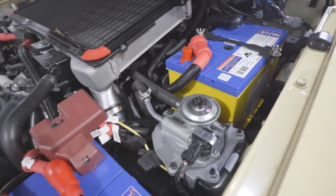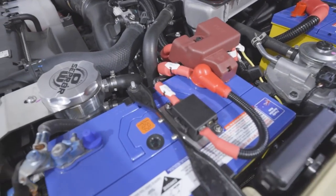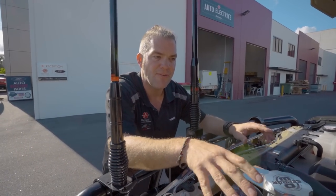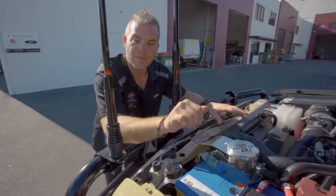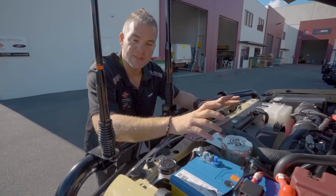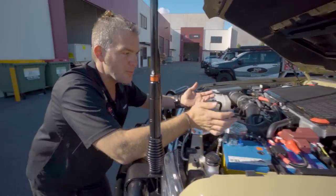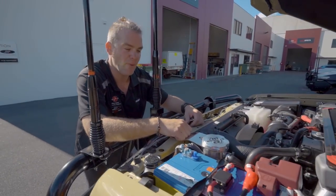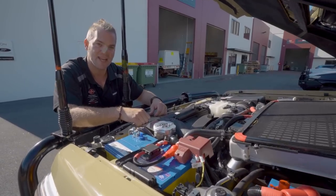That also works really well in case you do have an alternator failure and the alternator stops charging. Then you can press a button and instead of 3-4 hours of driving from one battery, you get about 7 to 8 from both batteries, which can be quite handy because sometimes that makes all the difference in the world if you can actually get back to civilization or reception or a road where somebody will find you, or if you stay lost somewhere in the middle of nowhere, because 3 to 4 hours of driving is probably at least 3 to 4 days of walking.